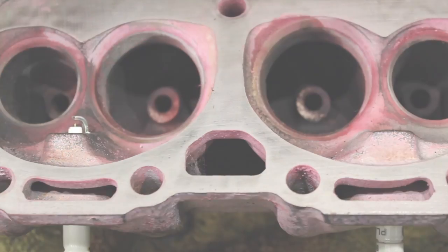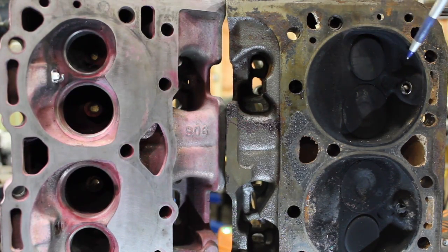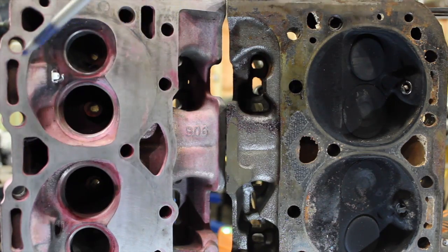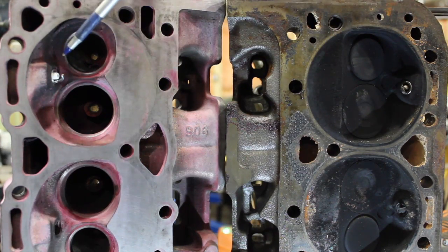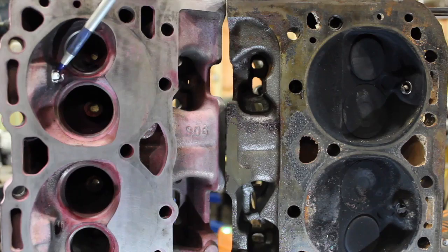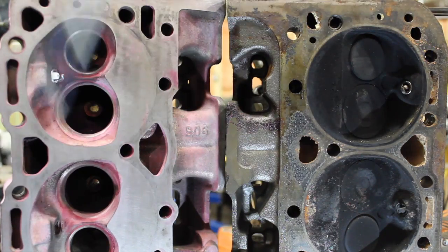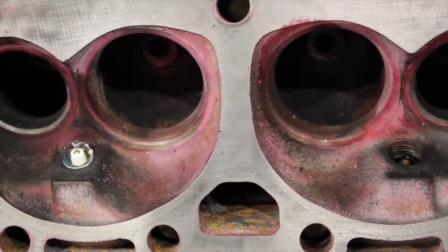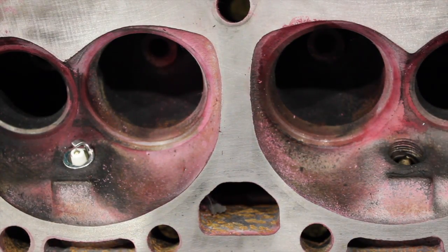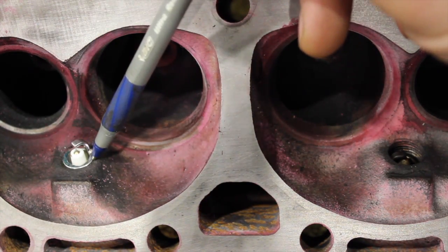Here's a side-by-side comparison of your old-school style combustion chamber versus the fast-burn or heart-shaped combustion chamber found on Vortec heads. There's the stock Vortec spark plug with the 0.708" reach sitting perfectly flush, and there's the old-school spark plug - see how it's perfect on the old-school head, but it would not be good on a Vortec head. Here's another shot showing how far that spark plug sits down in the hole versus being flush.